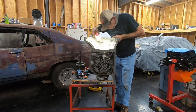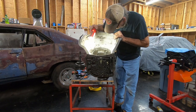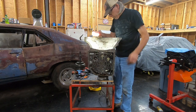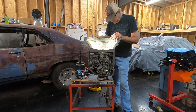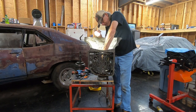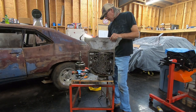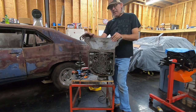I think that is all that's left other than my shift selector - the rest is just case. So now I've got to figure out what I'm going to do. I'm pretty sure the case is junk. With a little bit of scarring in my 1-2 shift piston or accumulator, whatever you call it, and the lug broken off the inside of the case, plus where the anti-clunk spring is it's pretty scarred up. I'll have to phone a friend and ask if that's junk or not. The case is probably junk, but I do have another case that is hopefully in better condition and easier to get apart.